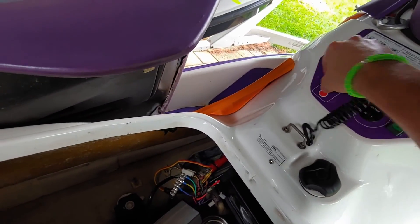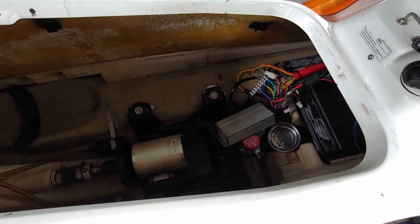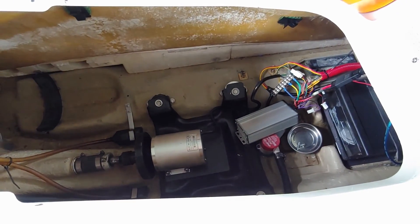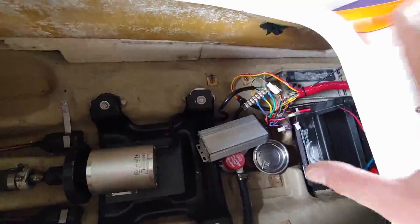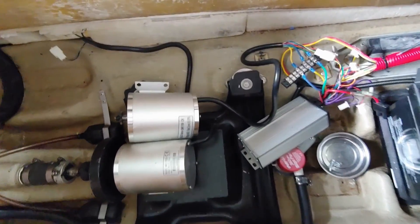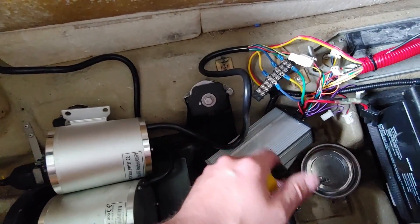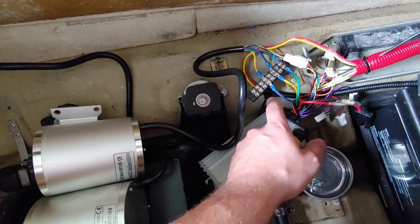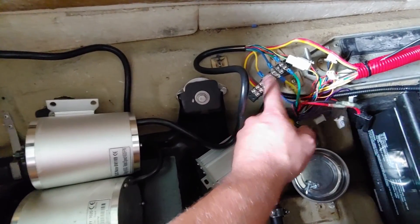Power cycles - yep, doing the same thing. So we know the controller is good. The motor's got a flat spot like I said before, or something else electrical is screwing up somehow. You can see the new motor is installed. We added one of these little channel bridge connectors because during diagnosing we need to be able to connect and disconnect. The waterproof idea was great but we need to be able to diagnose this thing if something happens, so that's why that's there.